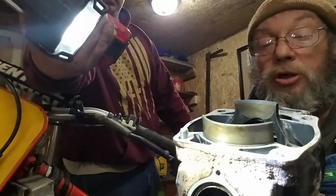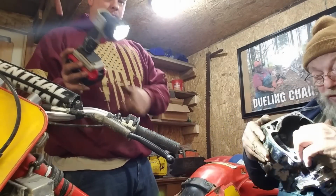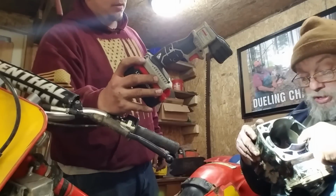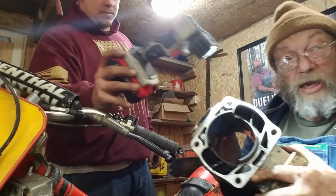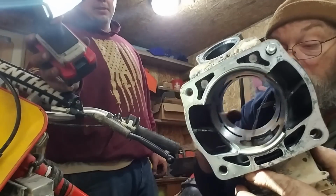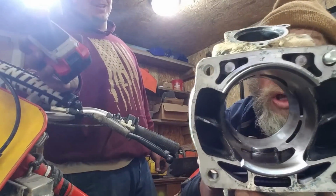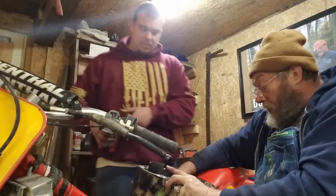Okay, now here's something when you see this. You can go in that area and just run your fingernail. I'm gonna tell you what, there's no wear on that cylinder. And there's a lot of sleeve left. Oh yeah, I got a feeling we're standard bore. That'd be nice, I'll tell you that. I got a feeling we're standard bore. Could we bore it? Yeah. Should we? Not if we don't have to. Let's clean it up. Okay, here's where we're at.